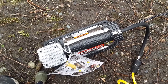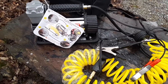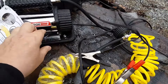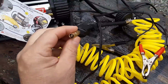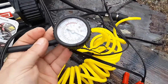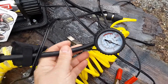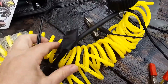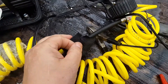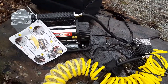I must say I'm impressed with this little thing. I pumped up two tires from 25 pounds up to almost 50 in less than three minutes. The thing does get hot, and I'm not a big fan of this chuck. The cord is nice and long, and I like the air gauge on the hose — that way I can leave the compressor closer to the vehicle and it reaches front and back without having to go back and check the compressor gauge. They also include fittings for a football valve and air mattress. I'm going to let this cool off before putting it back in its bag.